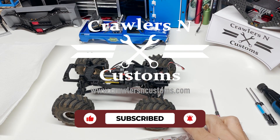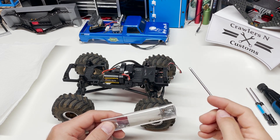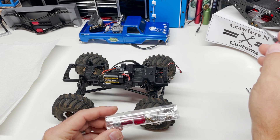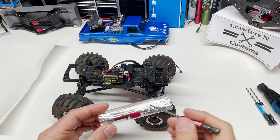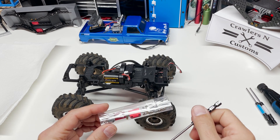You don't have to have a racing chassis to do this — if you just want to delete your shift servo and lock it in high speed, all you need are these two little shims, which are part of this kit. You can also download these in the product description for our PTW and print them yourself, but if you buy our kit it will come with them in the bag. We'll put a link in the description below.